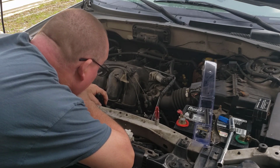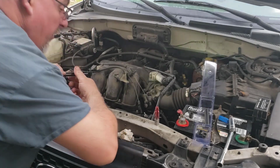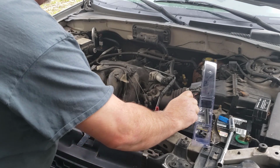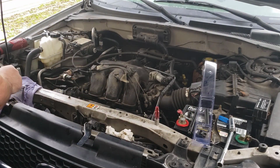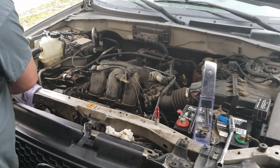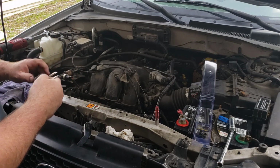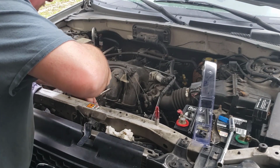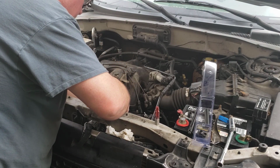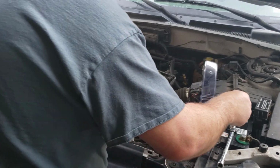So I see my seat is actually down in there some. So the objective would be, we want to get a full thread in there. We don't want to bottom out and not be deep enough. What I'm going to do is get my calipers here and measure down to the piston as well. The reason I'm doing it is to make sure that my tap doesn't bottom out. Got about 1 5/8 inches.